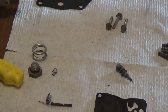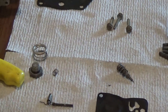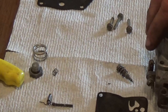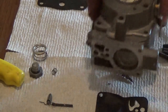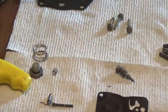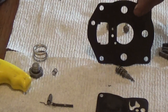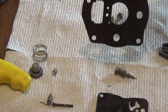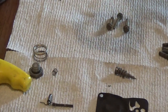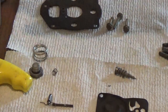I'm also going to tell you that these screws of course are the screws that go for the fuel pump, and these screws are the screws that go onto the upper and lower body — here, here, here, here, and here. And of course this gasket is just your carb gasket. Now there are several different styles of these. When you buy a kit, you need to make absolutely sure that you're using the right gasket. If you don't, it can actually be a pain, because if the gasket covers over one of your holes here, then naturally your motor isn't going to run properly.